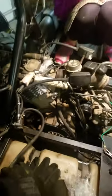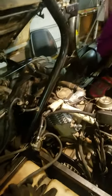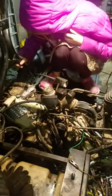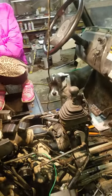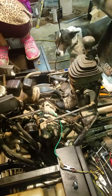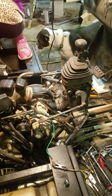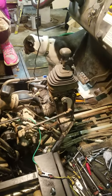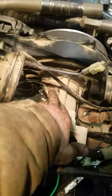I also took the cover off on the flywheel side and installed a pulse coil — or pulsar coil — which is what tells the ignition coil when to fire. Installed that, no change, still running like crap. I then swapped all the relays around, tested all of that, tested the voltage. I was getting close to giving up, but I kept honing in on the fact that it would idle just fine and rev up fine in neutral — the instant you put it in gear it would start running bad, kick it back to neutral and the problem went away.